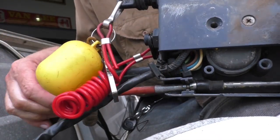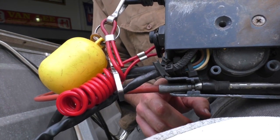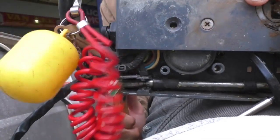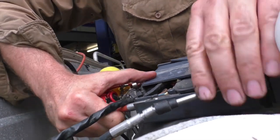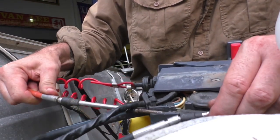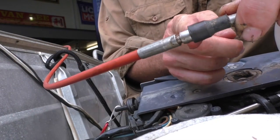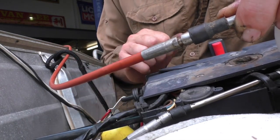This old red cable in most instances will slide out pretty easily, but in this case it's quite stuck and quite corroded. So I'm going to grab a hammer and just give it a few taps in the back here, hoping to push it forward through towards the camera. Okay, it's out. All that really was, was corrosion around here — but really it's just this groove slotted down into the forward controls. There is nothing holding it in other than that top plate we removed first up.